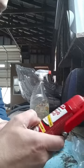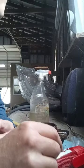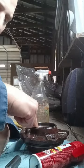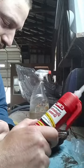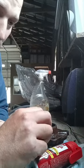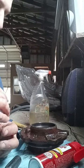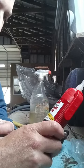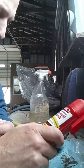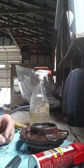This grease will disperse easily in oil. It won't stay there and it'll go away. If you have big gears like this with bearings, this is not going to harm anything. Now, for hydraulics, if you have something very fine with small orifices, there's a different type of grease, Dow Corning number 4, for O-rings and seals, and that's perfect in those applications. This is kind of the equivalent of like 111. I like this stuff. So I'm going to put some of that in here, and also a little right on the edge here just to help that seal go in a little bit easier.